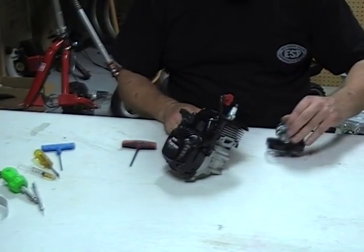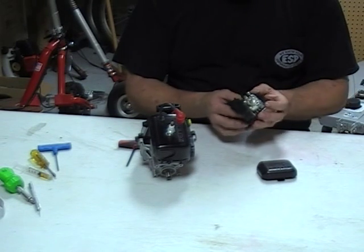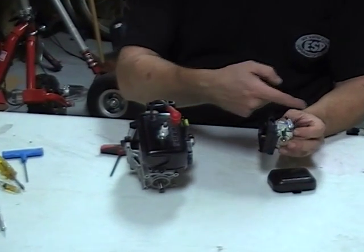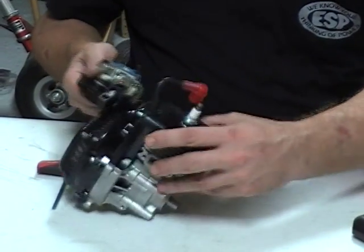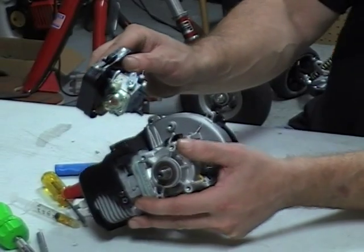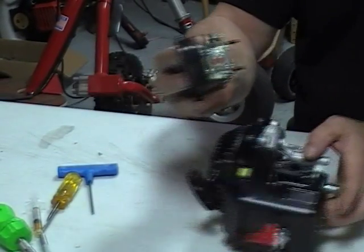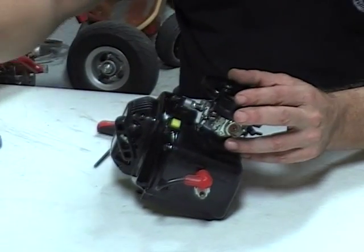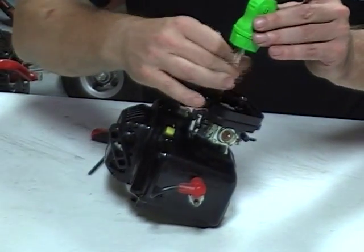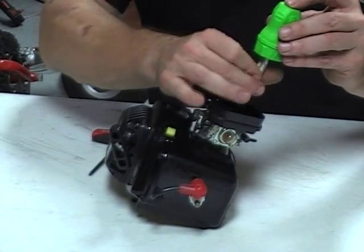This is the stock carburetor and stock air filter. Not too many people use the stock air filter — I always change to a different filter. You've got to be careful of the length of the carburetor bolts that go all the way through the carburetor and into the manifold. You don't want them to come all the way through the manifold too far because they'll hit the gasket surface of the cylinder and could cause an air leak. That's a very common mistake — many engines I get back returned have damage on that gasket surface which could have caused an air leak.